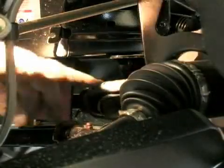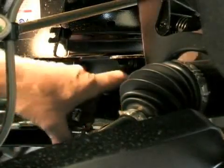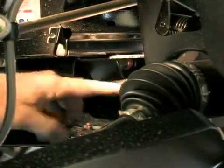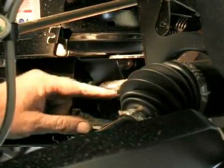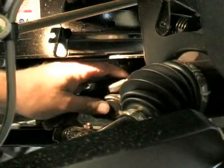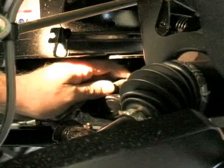There are a couple of U-joints on the Polaris for the front drive, and they don't have grease zerks on them anymore, but they have a pin that locks them on. You need to make sure that they're not all rusty, that there's no damage, and that the U-joints don't have any play back and forth that would indicate they're going bad.